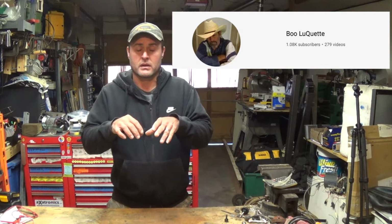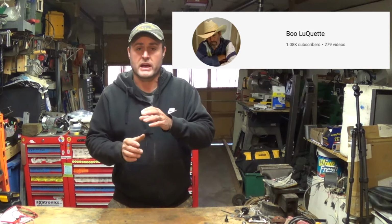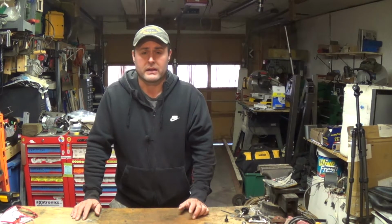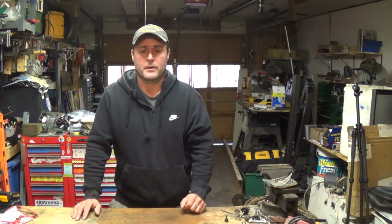But anyway, that shear pin's on top, and in the case that you hit something really hard with a regular lawnmower and the blade stops suddenly while the flywheel is still going, it's going to shear the pin, hopefully, before it messes up the shaft and all the components of the engine. I went ahead and pulled off the flywheel on this thing and checked it out. That shear pin was still fine. So I put it back together, and I thought, well, it's not happening all the time. That's part of the reason why I thought it wasn't the timing.